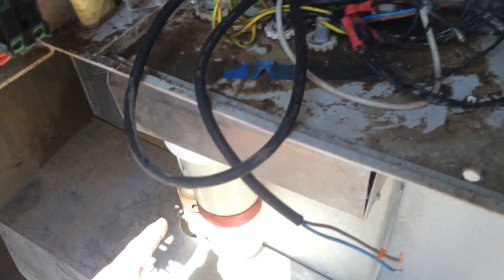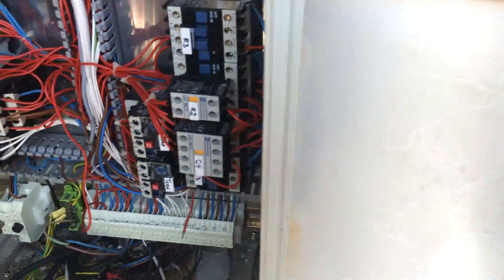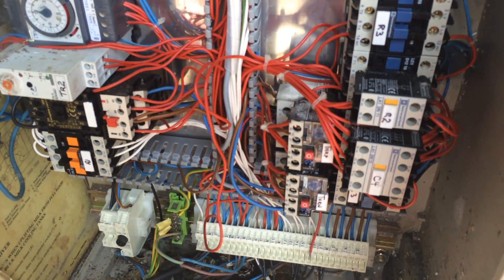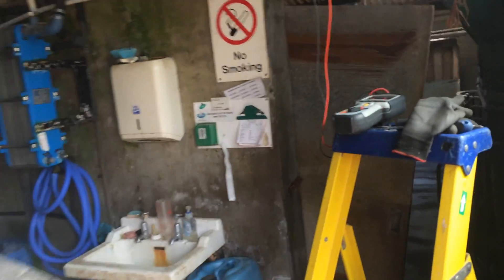It's either going to be the valve that lets water in to wash the chemical out, or the little booster pump up on the top there. I was measuring between live and neutral and had 15 ohms, which seemed pretty low. But I traced it back to the actual motor and the windings are about 12–15 ohms, so that looks like it might just be correct for that motor — I've got no detail for that.